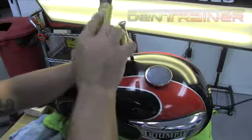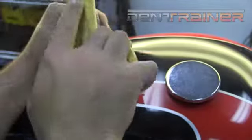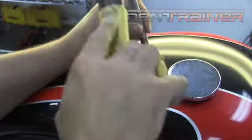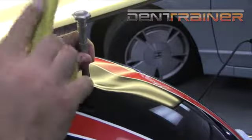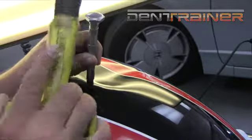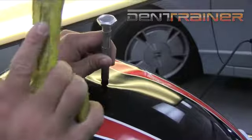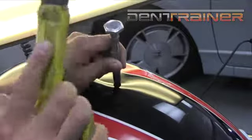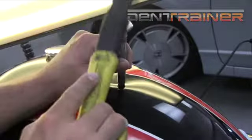See a little better view there. I'm kind of resting my arm there and just tapping away. This thing is tough — if you notice here, I am smacking that knockdown and it is just barely moving the metal. You can find that about tanks; they just have such a much harder type surface. Much doesn't flow like the thin metal in cars. But as you can see here now, I'm actually cross-checking the crown. I flip my light around and I'm coming at it from the back side, doing all my little hits in there. You can, if you look up close, see where I'm starting to see some movement there — I'm starting to see some little hits appear and that crown's starting to move downward.